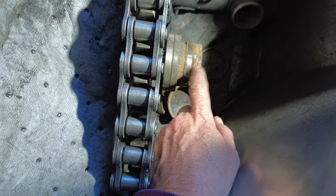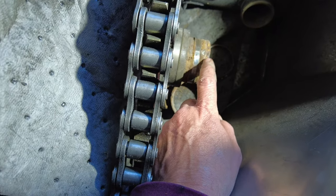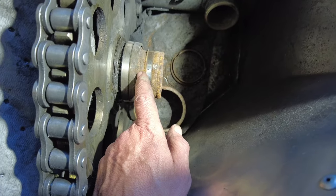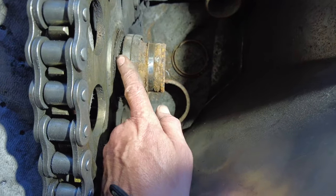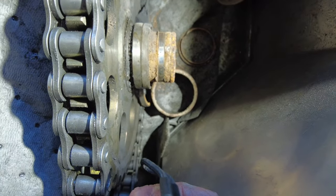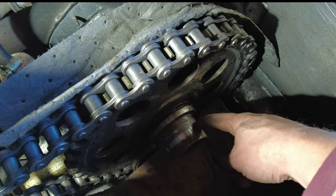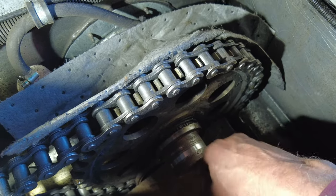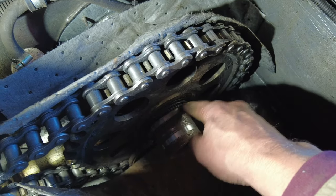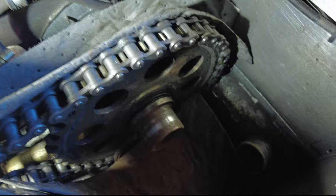We made some progress. A little bit of experience helped too. I was able to pop off the first bearing's inside race that's on there. I'm going to try to clean all this up - this seal here might even be decent yet. This bearing actually seems to be absolutely perfect, so I may be able to slide that off. I did get all this part right here sanded, though it probably should be done even better. I have one more bearing to get off right there. This bearing was probably pretty good, but I've been prying on it so much I pretty much broke it. I couldn't get it to move, so I've got to cut it off with that right angle grinder.